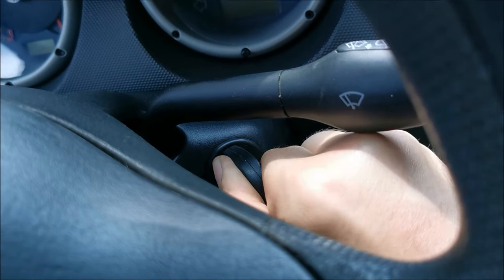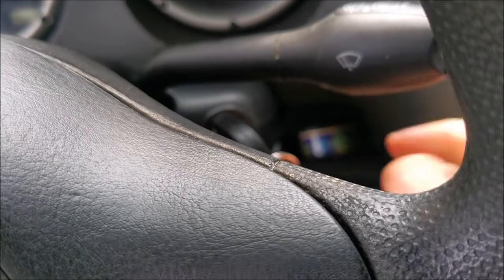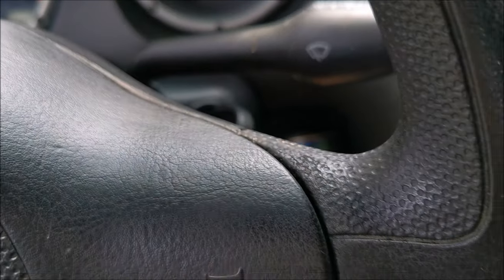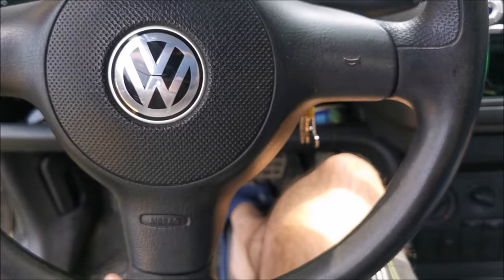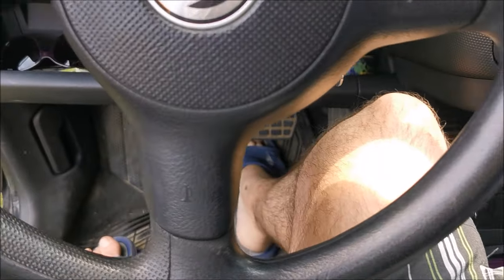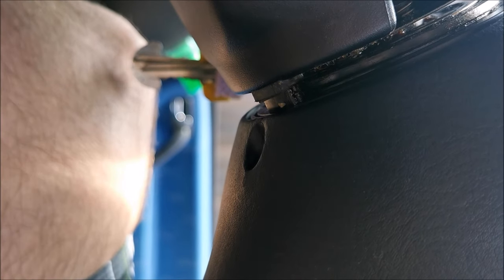What you want to do now: put in the ignition and rotate it just enough — I need to move the steering wheel a little bit. So this is not locked anymore, because you need to rotate it and on the back of it there's a hole. In that hole we need to put in a flat head screwdriver, and I will show you what to do with it.